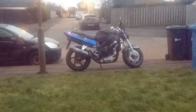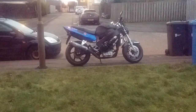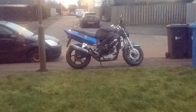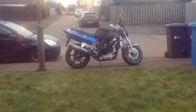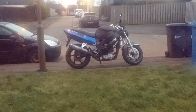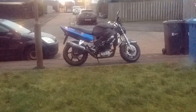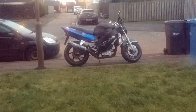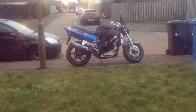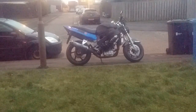The bike won't go above about four or five thousand RPM or 50-60 miles an hour, and I think that's because of the carburettors - not enough fuel getting through. I think it's running too lean, because I noticed the exhaust clicking quite a lot when I stopped the bike - too much air and not enough fuel. So I need to set it to run a bit richer and maybe balance the carbs while I'm at it, and that should fix that.